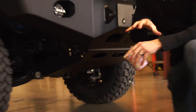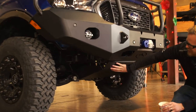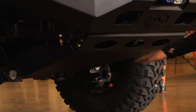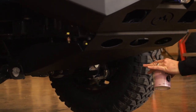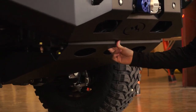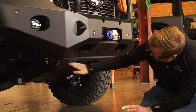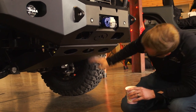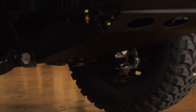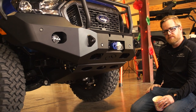It's really surprising how low the frame sits on this thing — the bottom of the frame flange is literally right there. The OEM skid plate sat down a bit lower, leaving a really weird gap. We didn't want to make the bumper super thick, so we just built our own skid plate here. This skid plate has ventilation running right through it, which is nice, and we also have a mid skid plate back there that replaces the really thin OEM skid plate.